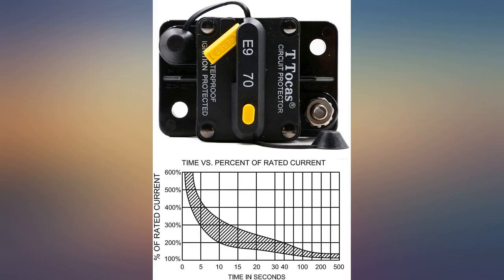I used this breaker on the 12V supply of a 2000W inverter in my motorhome. So far it's working perfectly. I tried two different breakers of another brand in the exact same application and neither one would work for more than a minute or two when I ran my microwave — that's about a 150 amp draw. This one hasn't popped yet, so I'm a happy camper.